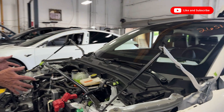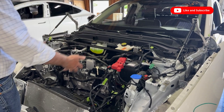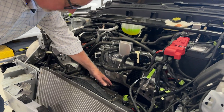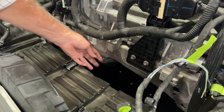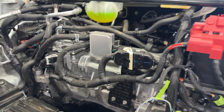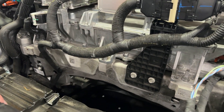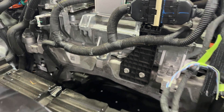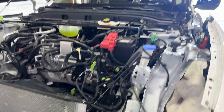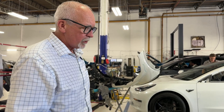They bring all those components up to the front of the vehicle because they've decided to put the charger port there. From here, this then has to go into the battery pack, which is essentially behind it and below. This is a single motor car, so you might see a dual motor car with a drive unit down here — in this case we don't see a drive unit, just the charging and thermal management system. We do see a piece of cast aluminum for this front crossmember, and a piece of extruded aluminum, very similar to Tesla — so they're making progress to reduce weight.